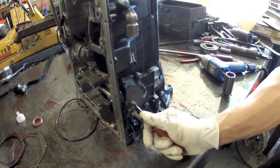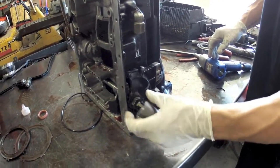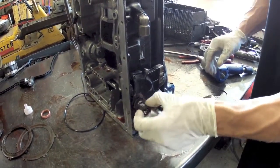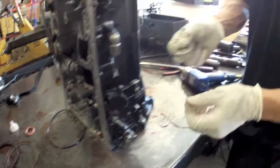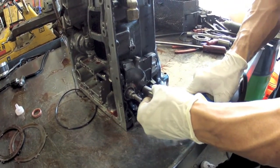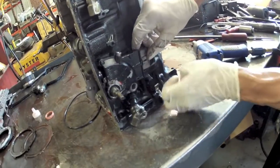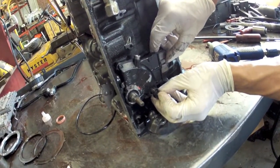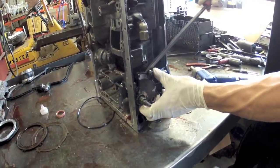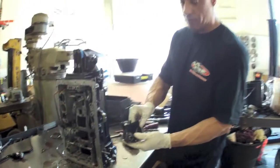Usually there are 4 or 5 tabs to bend up, and this nut usually isn't too tight — it's a 24mm. The retainer sits underneath it, and there's also a 12mm. When you put this back on, look for a witness mark where the old switch was positioned exactly, because otherwise it can give you problems like maybe not starting in neutral. Try to gently pry it off — if it gives you any trouble, it's going to break coming off, so you'll have to take the whole shaft off instead.